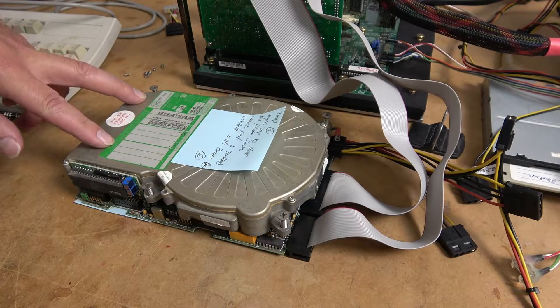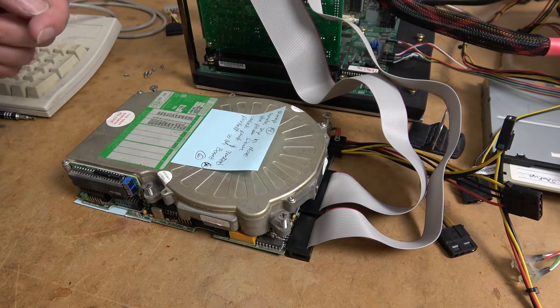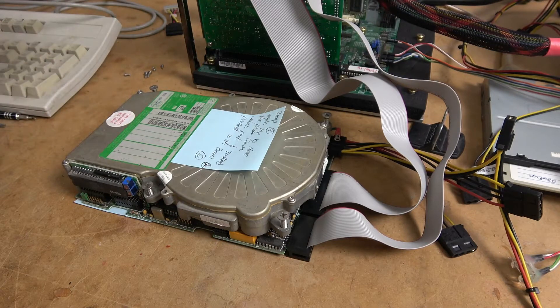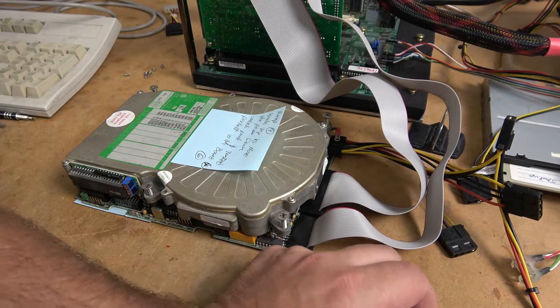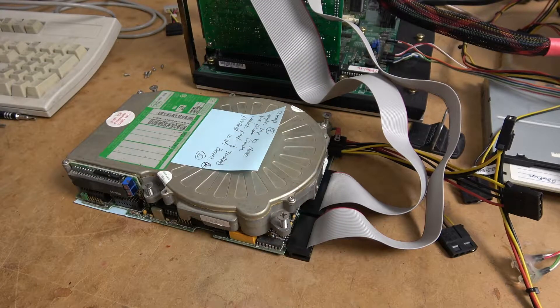I took the lid off of this drive and manually unlocked the heads so they would move around on their own. When I power on the drive it will spin up, activate the heads — I was able to do a low-level format, an fdisk, a format with a surface scan, plus a scan disk. Everything you're supposed to do at least within the Windows environment. It found no bad blocks — it's a perfect drive. The only problem is with the solenoid not working, it won't activate the heads on its own, and I want to have the auto park feature enabled. So we're going to take this replacement solenoid, pull this drive apart, replace it, put it back together, and hopefully have a perfectly working hard drive.